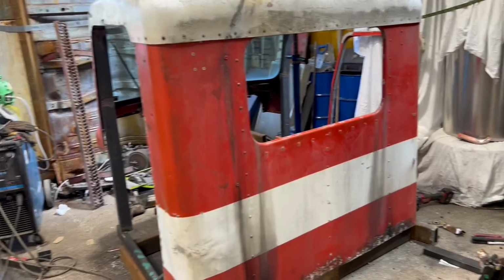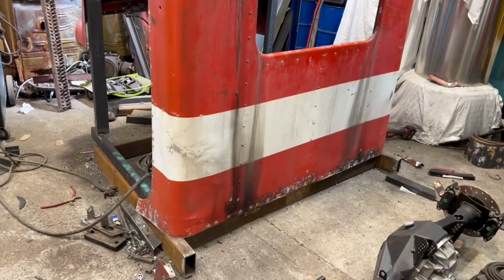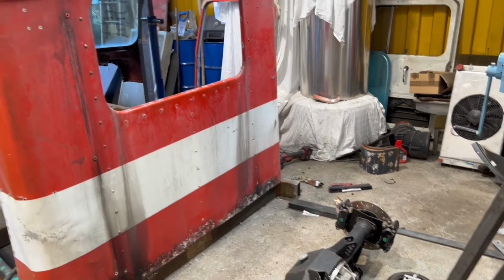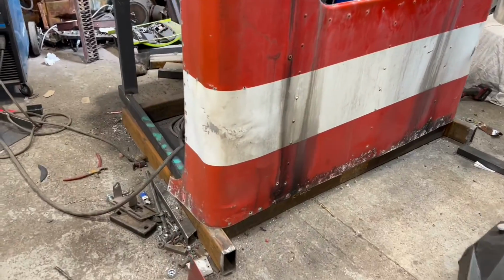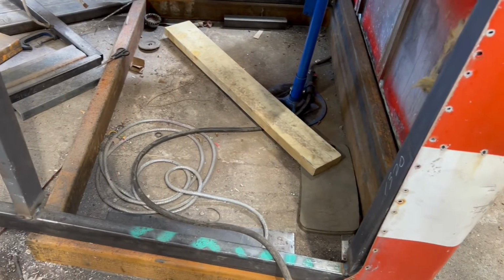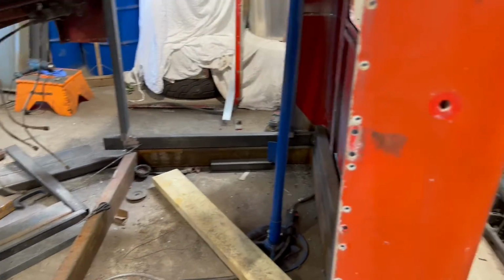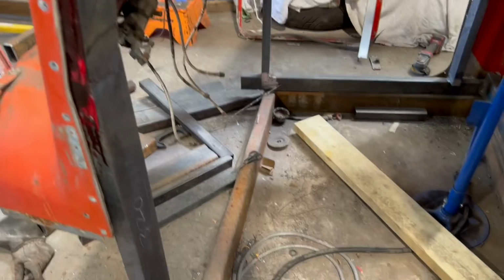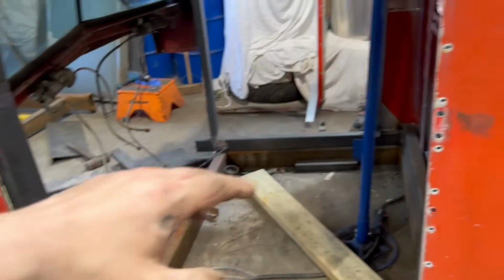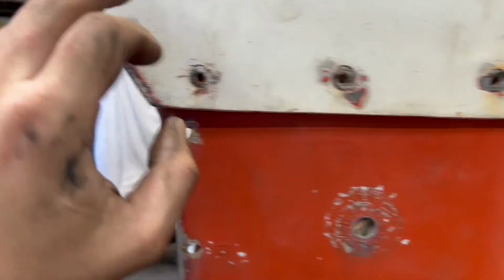Anyway, with that said and done, I'll jump into the video and you can see the process of me making this. And I'll probably bring you back in the next video and I'll have done the cutout, the floor braces, and I may have even put the bulkhead or firewall and everything else back together by then. So the plan is to obviously set this up, drill all the holes, so it's ready to go. We'll sandblast this frame, prime it, get it painted in 2K, and then can do final assembly of the cab once I've gone around and just refilled all these holes and made it nice.